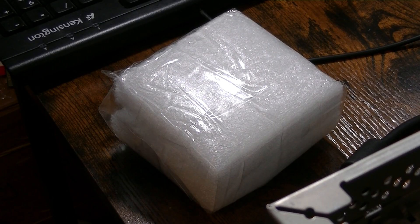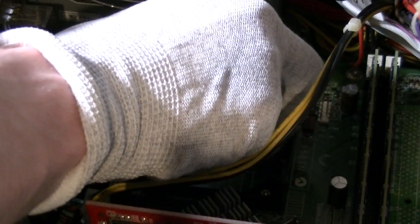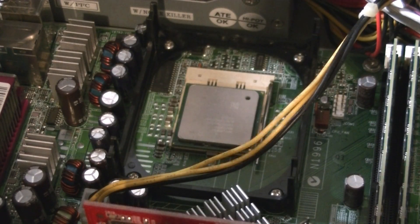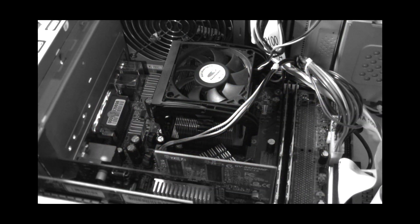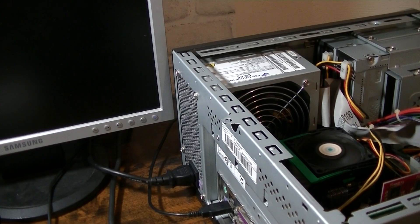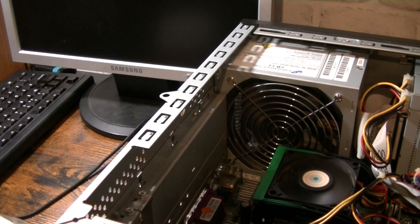Here is the second replacement Pentium 4. I'm much more satisfied with how this one was packaged — very thick packing foam, fully taped up. After cutting through the tape, I opened the package revealing the processor in the center. I removed it from the packaging, confirmed it was the correct model, placed it in the socket, got the latch secured, applied thermal paste for the third time, and got the heatsink secured. After plugging the PC in and turning it on, the result was the same problem. I also tried reseating this CPU along with brushing the socket, but even after that, nothing changed.